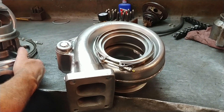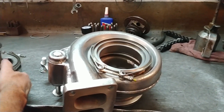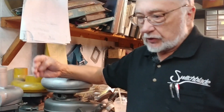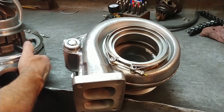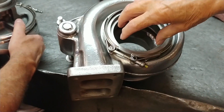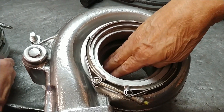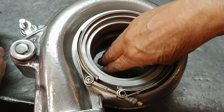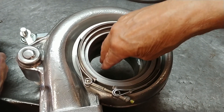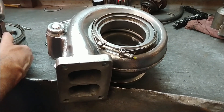Sometimes you get a turbo and your oil lines don't line up correctly. The Switchblade goes on so many different engines that we don't always know the correct alignment for your particular engine when you get it, so you're going to be faced with having to realign it. These newer turbos have pretty tight tolerances, and if you don't get it in totally flush and sitting down flat, the cartridge will cock in the housing. It might not be rubbing when you spin it by hand, but when you start the engine and put a load on it, it'll start pushing until it gets into the housing and you'll hear it grinding and rubbing. If you let it go very long, it's shot.